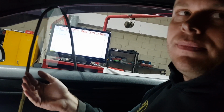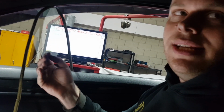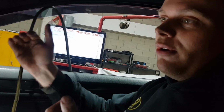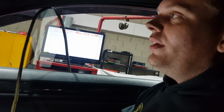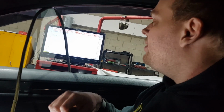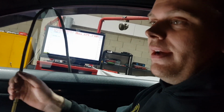to flow more air. So that depends if we go even higher in the boost than 1.9 bar, whether the airflow of the engine increases or whether the airflow stays the same, or even can decrease. Because the one thing, if you run tons and tons of boost, your exhaust manifold pressure will overtake the inlet manifold pressure, and what happens is you start reducing flow through the engine. So 1.9 bar, you know, might be fine. To do more might be the max. We'll have to see. All right.